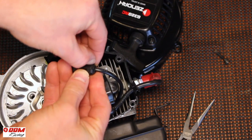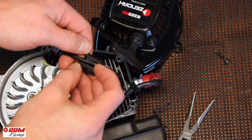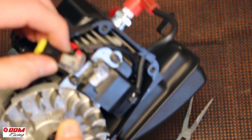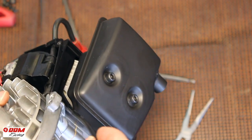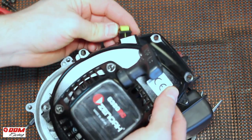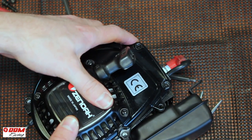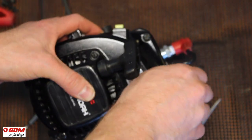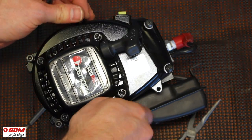Before we get to that, you do want to remove the interference filter — it's just a little magnet that clips on, so you simply open it up, set it aside, and we'll install that later. With the ignition coil back on, gap the coil to the flywheel just using a business card. Route the wires so that they go up and out of the fan cover. Reinstall the fan cover, making sure there's room enough for the wires, then reinstall the six screws. You can use a little bit of blue thread lock on those bottom four screws if you'd like.